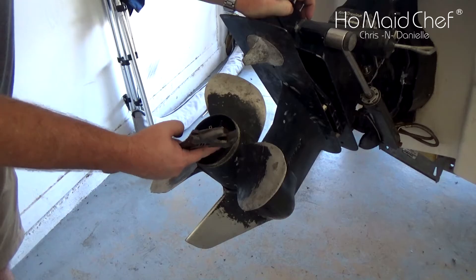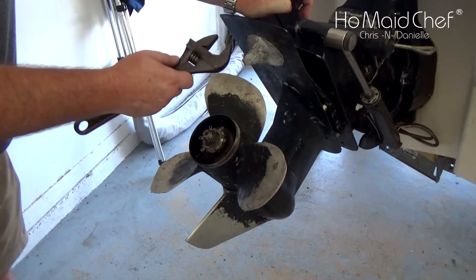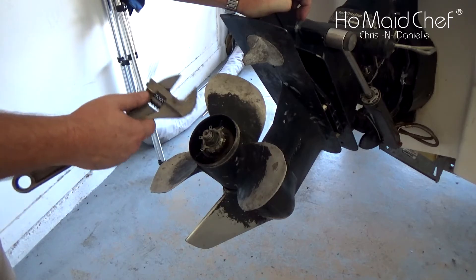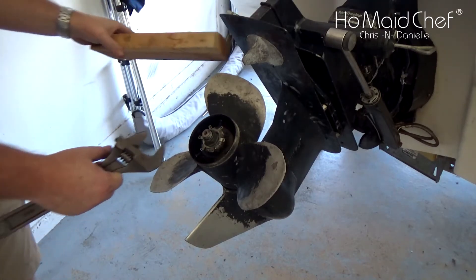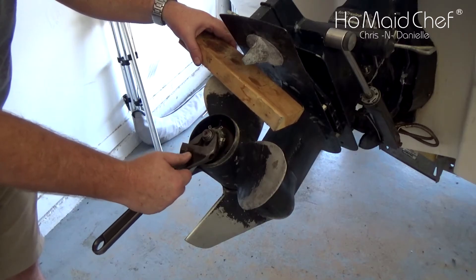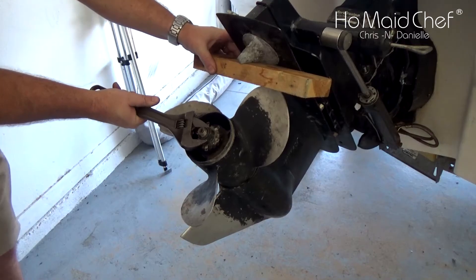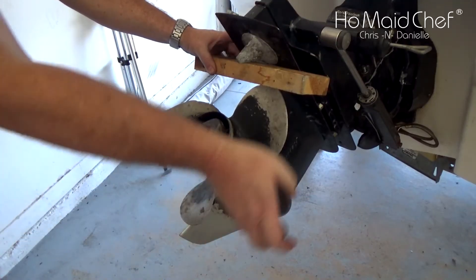When we dragged the boat home these tabs were already pulled out, so I'm guessing he just rode around like that. The problem with running too small of a prop is you can easily over-rev the engine — that's probably why there was a valve that bent. So let's take this off. I'm going to start by wedging my board in here like so. This is a small prop so it's going to be harder, it's tight. I'm going to loosen it — I did break this off earlier because it was just a bear to get off.